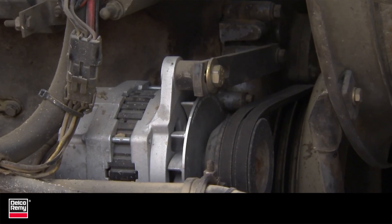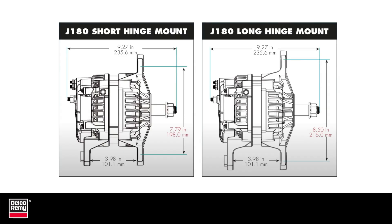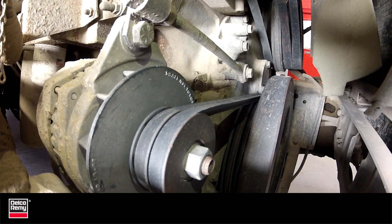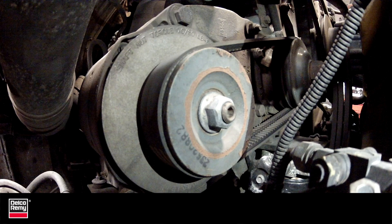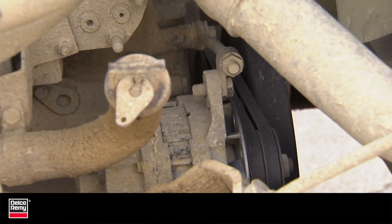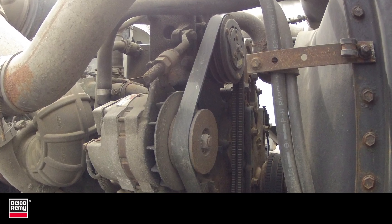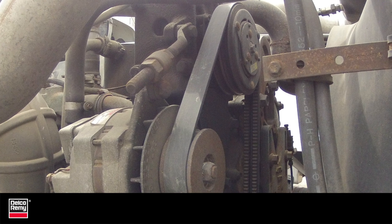Let's first look at examples of a J180 mount being used with an adjustable slide mount. If the engine alternator mounting bracket is an adjustable slide bracket mount, both the short hinge and the long hinge will fit in the bracket with no modification to the mounting being necessary. There are two reasons for adjustable slide mounts: first, the alternator is used as the main point for adjusting the drive belt tension and can be slid looser or tighter accordingly; and secondly, the different size alternator mounting spreads from different manufacturers can be used on that application as well.